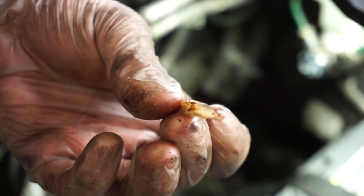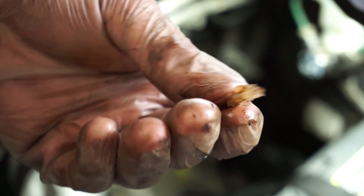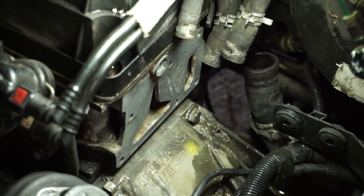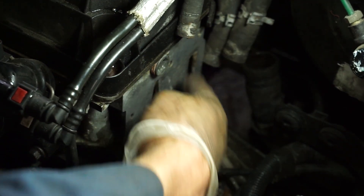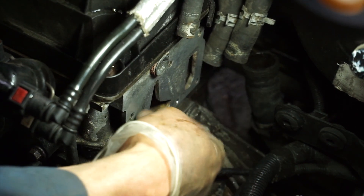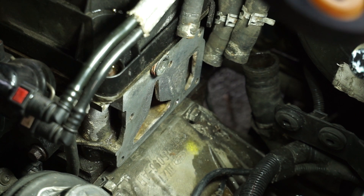Be really careful using liquid gaskets — a little skim might be fine, but when you put big gobs in like that, it's only a matter of time before it detaches and finds its way into your radiator core, water pump, or somewhere you really don't want it. You can at your own risk use some wet-and-dry on a flat block to polish the surface, but that's got to be flat. There's still some corrosion here — this has been run without antifreeze at some point, so the alloy has started to corrode. We'll see what we can do, but it's clean and ready for the new thermostat housing.